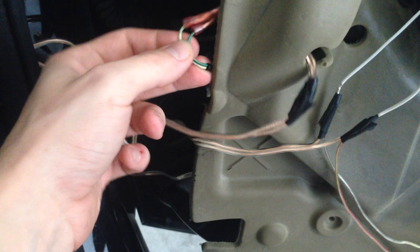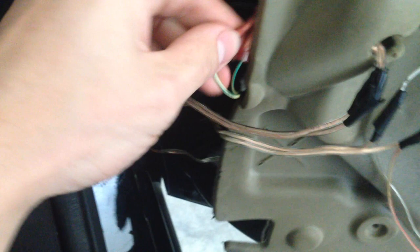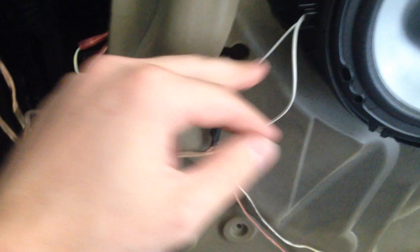Pull the doors off and you'll find the cords that normally run to the speakers. If you're running a stock sound system, you'll find two little cords that run straight into your stock speakers — these are the signals you want to tap into to connect your line converter. Cut these cables, work out which is positive and which is negative. The general rule is the solid colour is positive and the negative is generally a white with a stripe matching its partner cable.